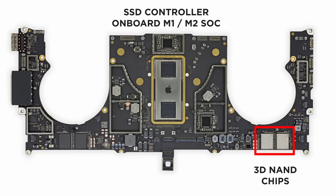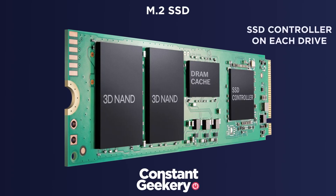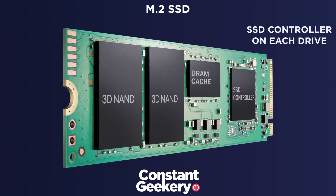Apple specifically doesn't provide any technical data on its drives. In an Apple Silicon Mac, the SSD controller is part of the M1 or M2 system-on-chip. When you look at the logic board, you can see the NAND flash chips, but this is a different approach to using a conventional M.2 SSD — and it's another reason why the drives are not replaceable with standard PC components. Apple has tightly integrated the controller with the software. Why would Apple go to the trouble and expense of approaching flash storage in a completely different way to PC manufacturers? They could have just used off-the-shelf SSDs — that would be cheap and easy and good for consumers — but it's another clue that more might be going on behind the scenes.